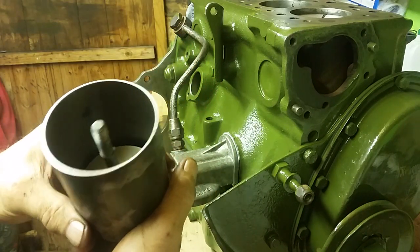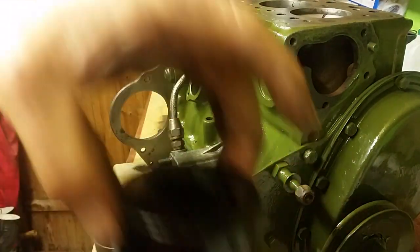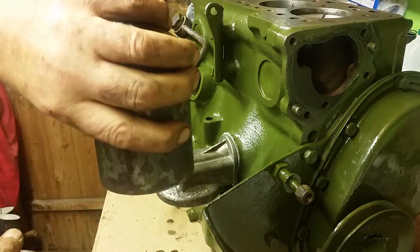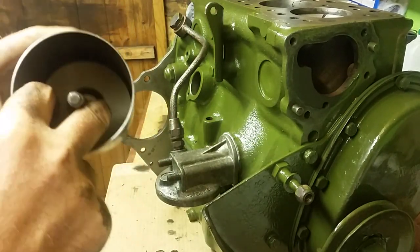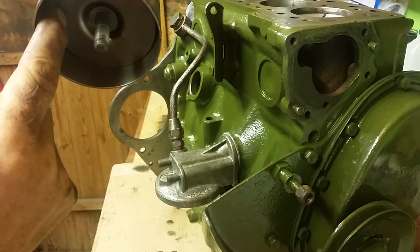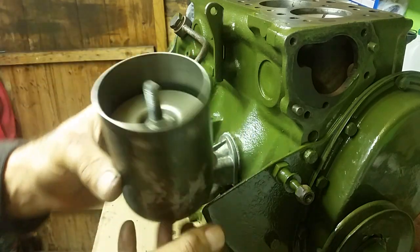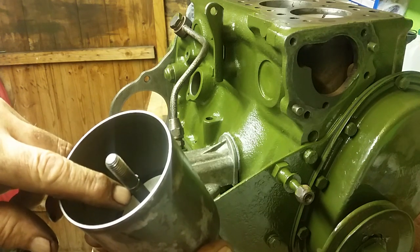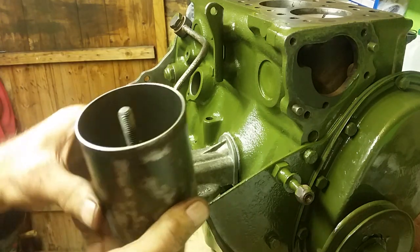It's too small to come back out. When you've dismantled this from underneath your engine to change the oil, you tip it over into the bucket. You can see the disc has slid right to the top - if that little piece of wire wasn't there, you'd lose the disc and the spring and your oil filter wouldn't be working at all. The guy who invented that has probably made a lot of money for Austin Morris - there have been millions of these produced.